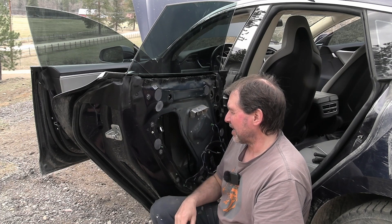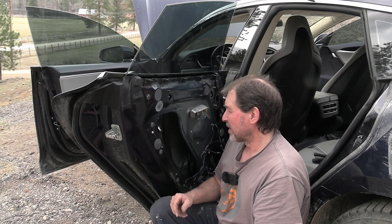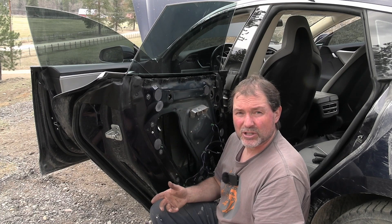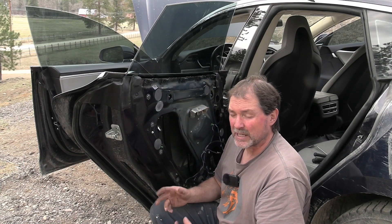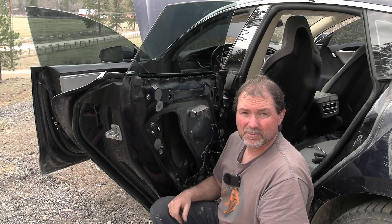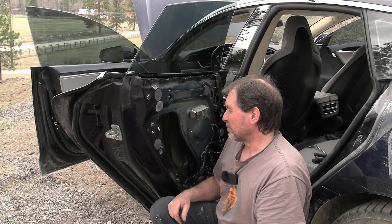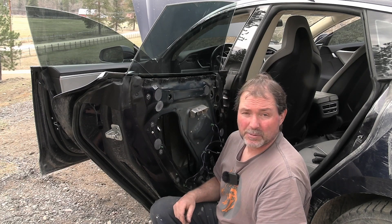I don't see anything on the door handle and the door handle wiring that would indicate that there is a short. So it could probably be in the motor that extends the door handle. Everything else is pretty much just switches on there. We got a light in there too, so it could be the light or the motor for the door handle — those are about the only two things. Everything else basically is just a switch, and the switch just makes a connection and opens a connection. So maybe I gotta get this door handle assembly out and look at it a little closer. I could leave it unplugged for now and just not use that door, so the car is usable.